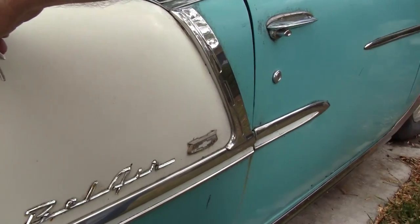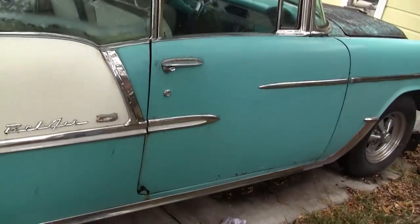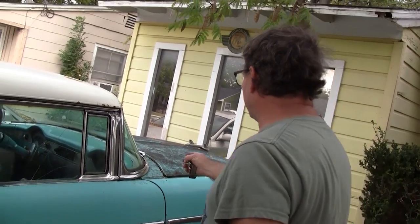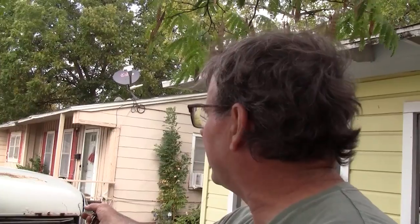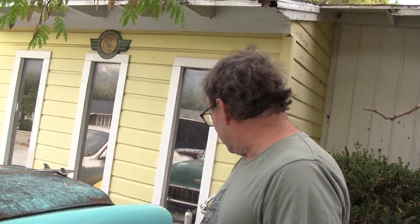under that. Only way something like that could get there is from the metal being bent. That is actually the original quarter panel. I straightened it out, I had to put another door. The passenger side door was only about this wide. This was all tore back, and I've still got some work I need to do there, but it bent all this back, and I straightened all that, but I had to put a whole new cowl section in it. This is 2 cars welded together to make one. You look underneath it, you can't tell it was ever cut in half. I try to do things where you can't tell.